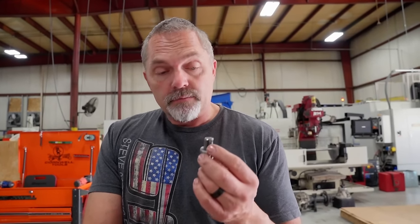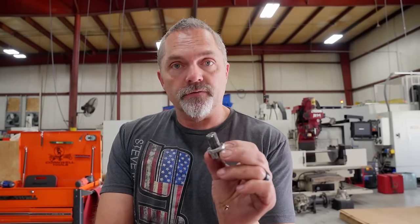This, I've already talked to the stud company. This is brand new. This is the first set of these main studs that we've ever used. This is the first block out of Bailey's machine. This is the first block with these main studs. I've already contacted and talked to the stud provider and immediately said there is a problem because these all torqued up fine, torqued up perfectly okay. Never even gave it a second thought, but that is a material failure.